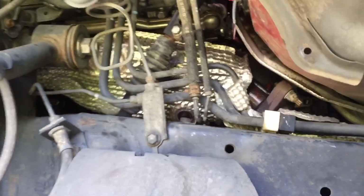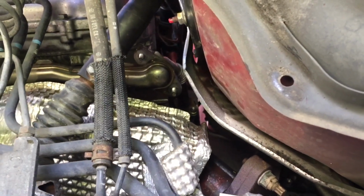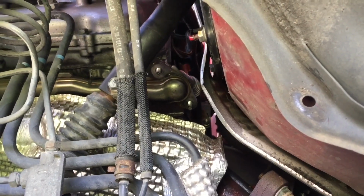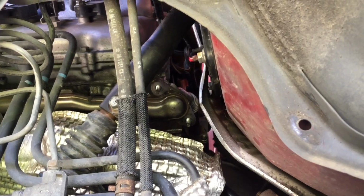And so far, I've got the wheel off, and this flap was up like this. Popped a couple body clips so you can kind of see up there. And right there's where we're going, where those two studs are. It had two 10mm nuts on it. They broke pretty easily, weren't too rusty. I even hit them with some liquid wrench prior.